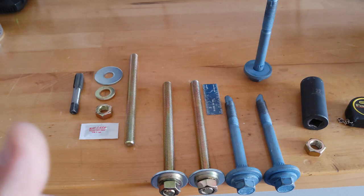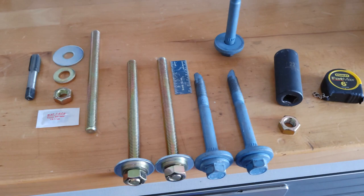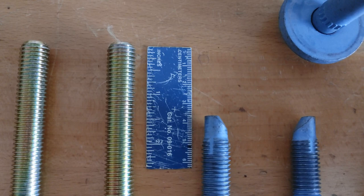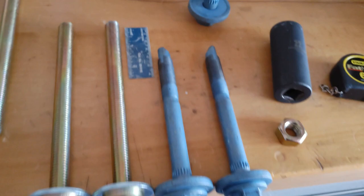There are additional features and benefits to go over. The first thing is replacing the factory bolts with the stud kit so everything's new. Using this ruler, you can see there's approximately two more inches of thread on these studs compared to the factory bolts. That unthreaded portion on the factory bolt helps it go in, but the nice thing about the stud kit is it doesn't need that chamfer because once it's in, it's in and you never have to remove it again.